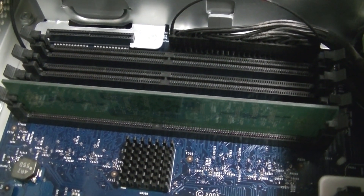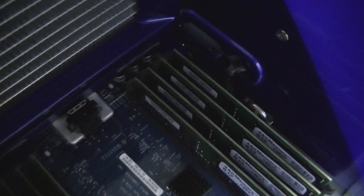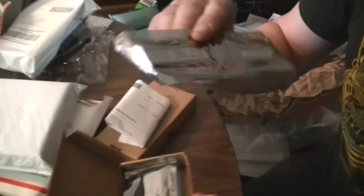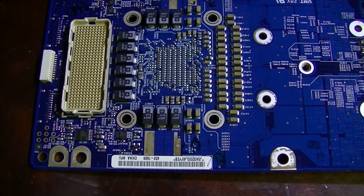With potential bottlenecks removed in the system bus, I was able to plan out a fantastically speedy Linux server and workstation of the non-x86 flavor. I started out with RAM and maxed it out at 16GB using eight 2GB DDR2 sticks. The memory controllers will only ever make use of 16GB of it. ECC is optional, and PC4200 is the minimum. Each physical processor communicates via a 64-bit DDR bi-directional front-side bus — there are actually two of those on this machine. This bus runs at half the CPU clock speed, so in my case that's 1.25 GHz.